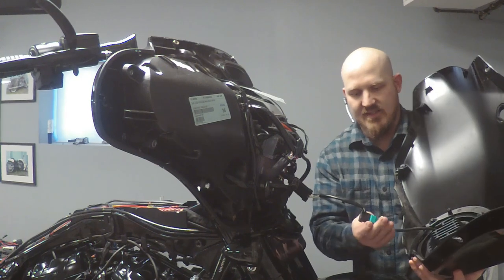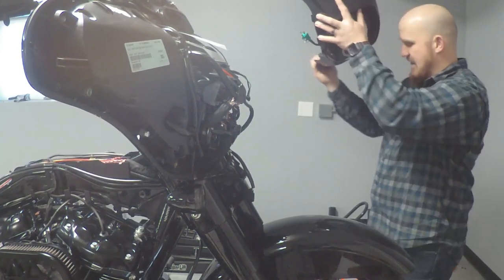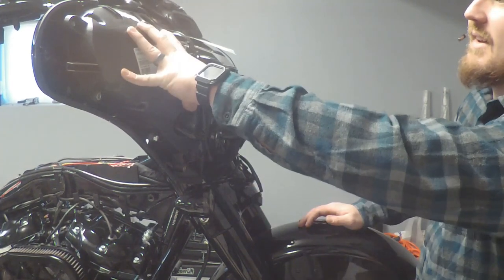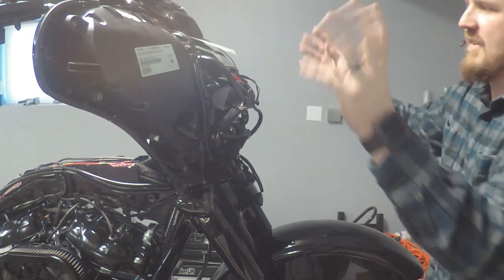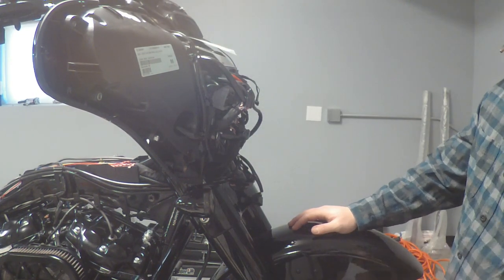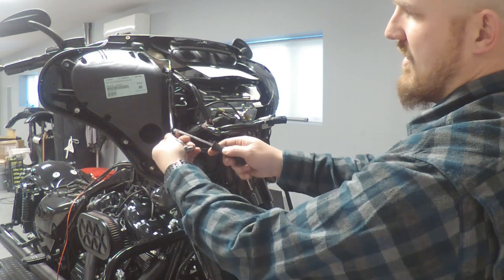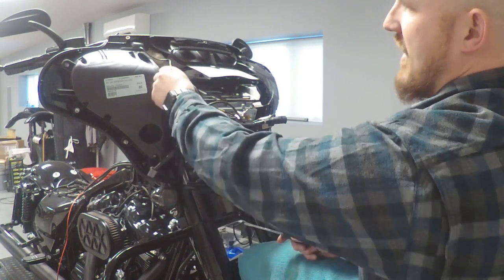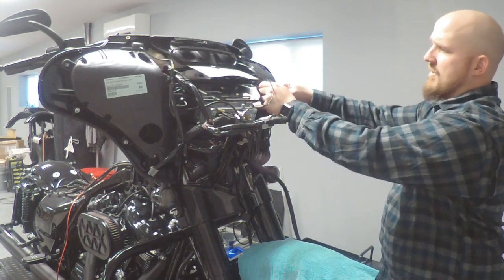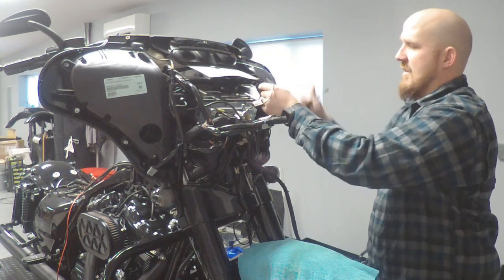It's pretty easy — it's just a plug, nothing special, pull that off and set aside. Now that we've got this opened up, we're going to go ahead and take these two speaker pods off, and then we'll be able to start drilling our holes for the ports and getting our new speakers put in there. Once we get this plug pulled, just use a little flat blade to get underneath there and pop these little grommets out, and then the same thing on this side — an upholstery tool would probably work a little bit better but we're just using tools that are a little more common in the toolbox.